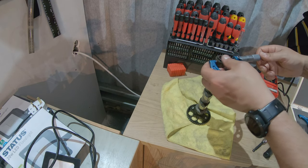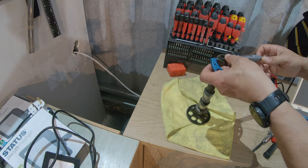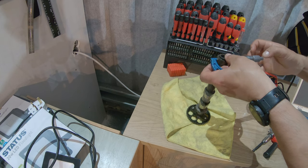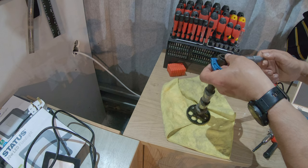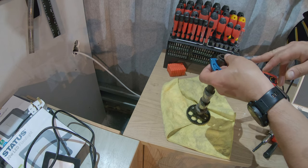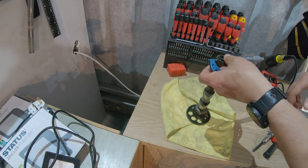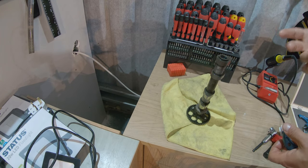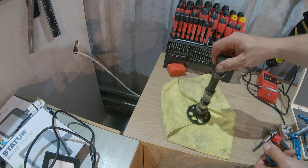So we open the tool and we just make sure we hit it exactly in the middle here when we take the measurement. So we close it. And you don't spin it from the part where you apply force, but from the back here. And when it clicks, it means that this is the maximum force that you have to apply. And we are at 40.25, and the measurement should be 40.25. So we are actually on the larger part of the lobe. We are close to the lower limit, but then the limit, the real limit, is 40.15.